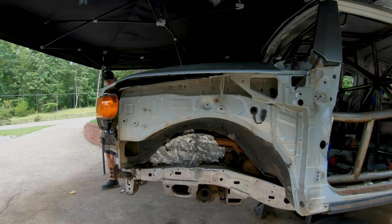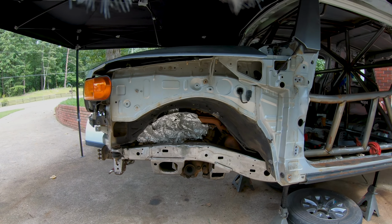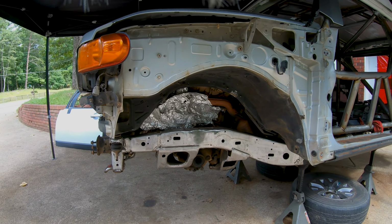We've got Mitch Fries at Mitch Fab. We've got his upper control arm mount going in there. You'll see that. That thing's pretty cool. So we're just gonna set our camber and get our alignment numbers as we need with an angle finder, or as close to good as we can for a couple of guys building our first race car in the driveway.